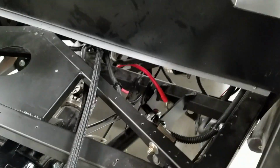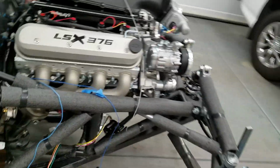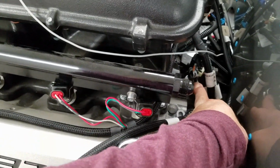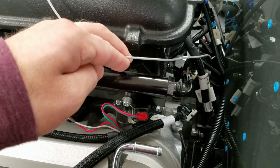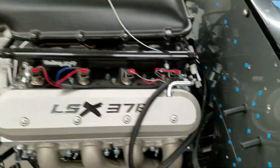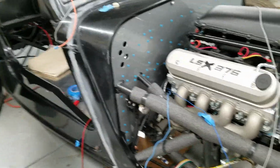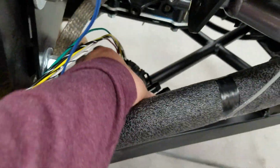And then, once I get that tightened up, I have a whole another mess of wires back here, the battery, all that kind of stuff. But it's coming together. And then I have one more wire here that I'm not going to use, the oil sense temperature for the Holley system. I'm going to pull this off, get a pigtail for this, tap it onto here with a ground, and have that go straight to my meters in my dashboard.